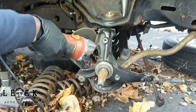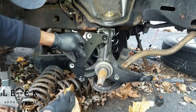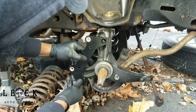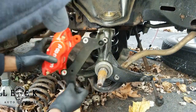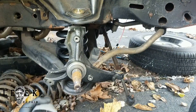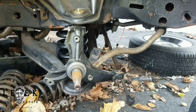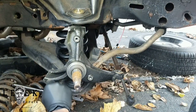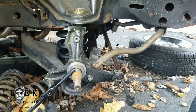Grind down the rough and sharp surfaces, then use the grinder to flatten them back down. Take the bracket and make sure you have the clearance you need — looks like I've got plenty. I'm going to drill using a 21/64 drill bit, and I used a 3/8-24 tap. I'm just reading off what they specify — whatever the instructions say, that's what I'm passing on to you.